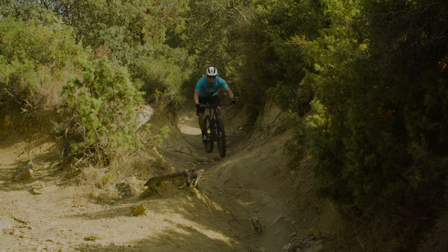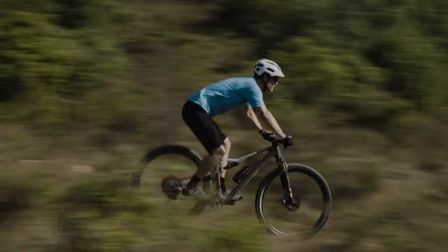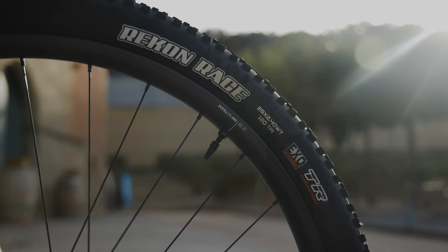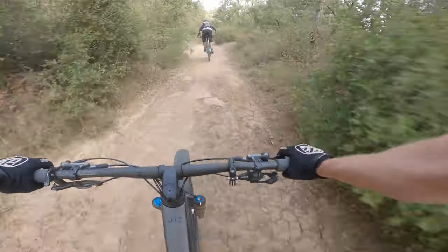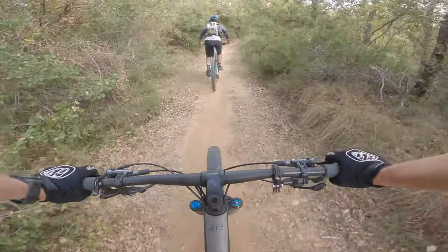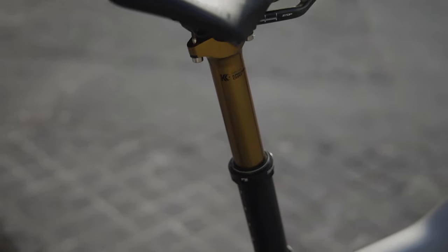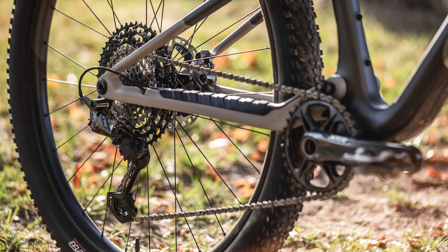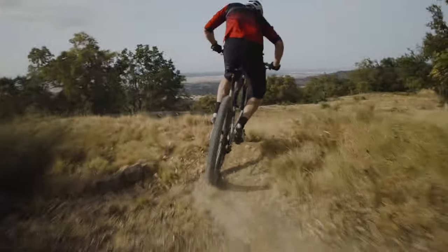While I love the Recon Race, it has its compromises — braking traction isn't the best, and cornering on loose surfaces can be exciting. However, the slight shoulder tread makes a massive difference to cornering traction on all but the most marginal terrain. In terms of the rest of the specification, the cockpit felt good, though there's a hint of harshness through the fork's damper. The Fox Transfer SL dropper is a slick performer but doesn't have infinite travel; I occasionally found myself hitting it too early on its return stroke, pushing the saddle back down. Shimano's XTR drivetrain was faultless, but I would have liked a touch more power from the front brake.